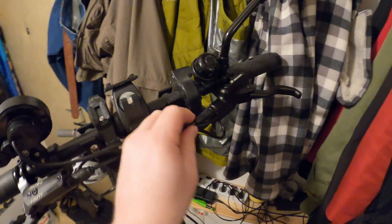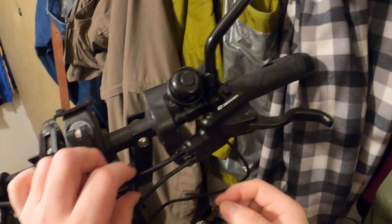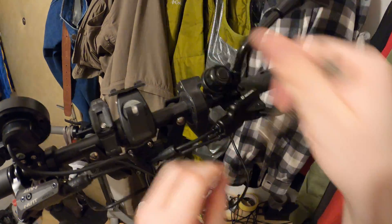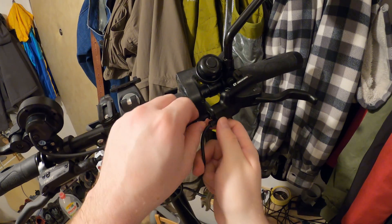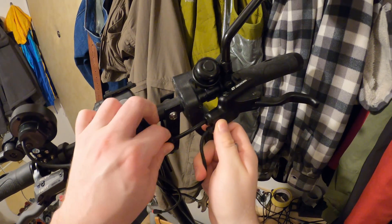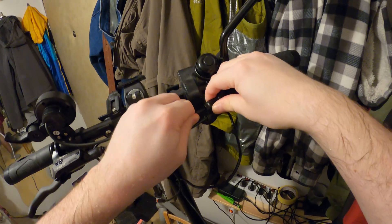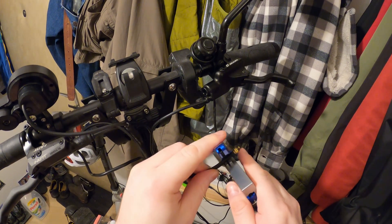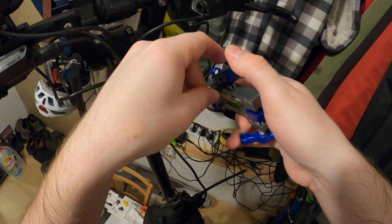Once you have drained the oil, you can take off the remaining zip ties and remove the protective plastic to get to the nut that is holding the oil line inside the brake lever. You will loosen this nut and that will allow you to remove the oil hose from the brake lever. It can take some force to remove the line because it's still stuck in place with the metal oil ring that was crushed inside, so just wiggle it a bit. Then to make the removal easier it's best to cut off the top of the line so when you are pulling it through the stem you won't have any hang-ups on the other wires.